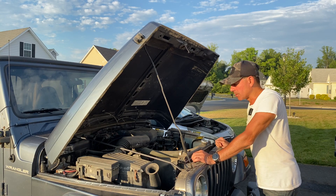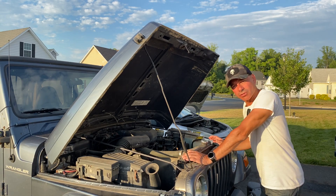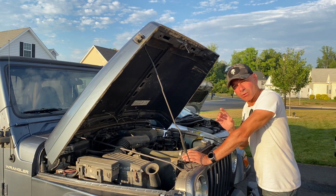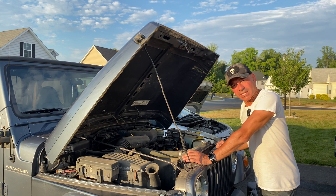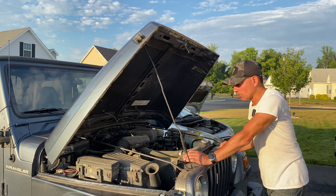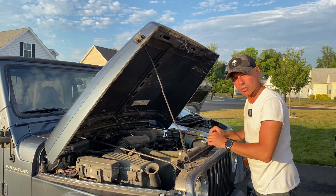Let's get a close-up here. For the most part, your alternators are grounded onto the engine block. That's only going to be a successful ground if the engine itself is grounded properly with a good ground. In those cases you would need to test that — that'll be covered in one of the videos in the description. But let's take a look and I'll show you how most of them are grounded.